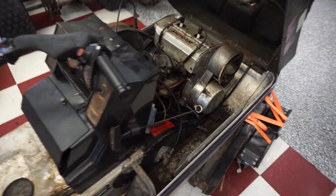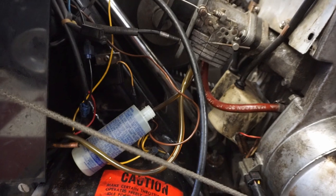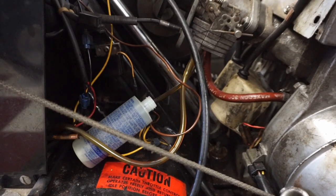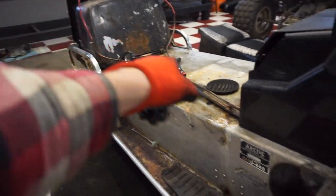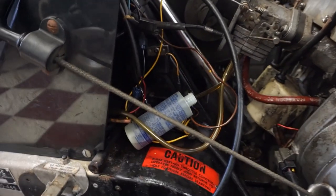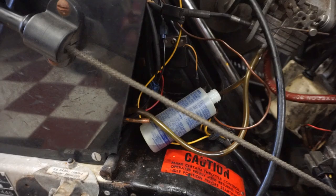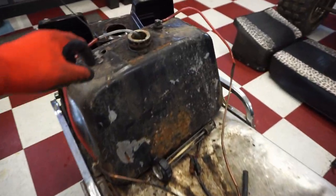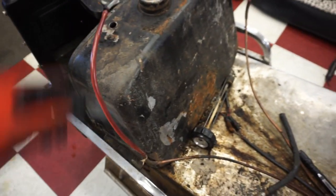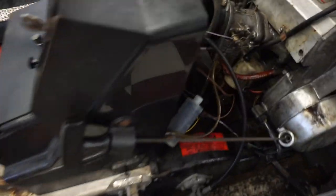All right, I think we have a turn of events here. I was looking up online and they said sometimes the pump needs to be primed. So I first got gas down this line, the main line, and when we got gas up here, it was actually pumping to the carburetor. I was like, what the heck? I tried messing with these lines, and it seems like it's not sucking the gas up from the tank here. It can't get past this point for some reason, but it can suck it up through here.